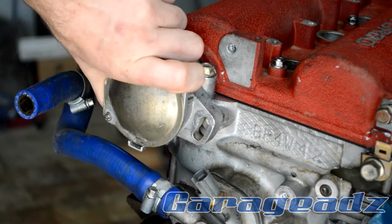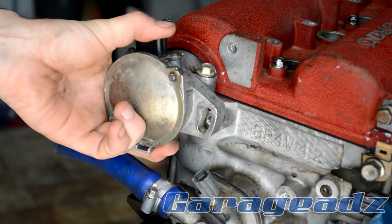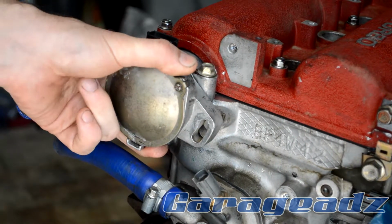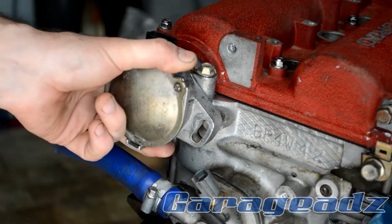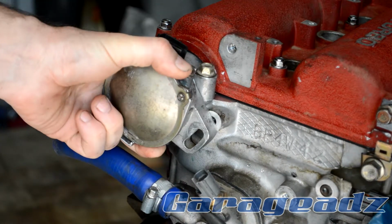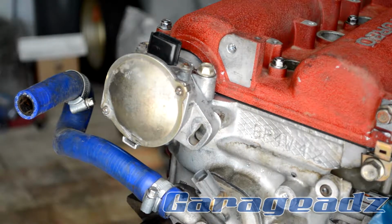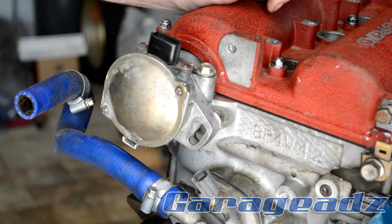So ultimately what happened was, because the head's soft, the bolt backed out, the crank angle sensor moved around, and advanced timing so far that she was making good oomph, and killed his motor. So anyone that has one of these Mazda BP motors, please, at your nearest convenience, helicoil every bolt on the hot side of your head, and that will save your little tiny motor.